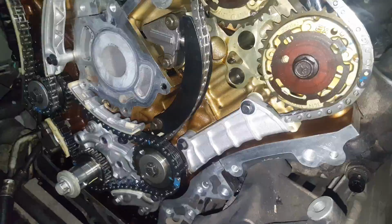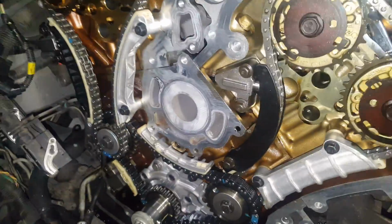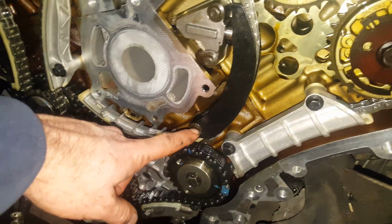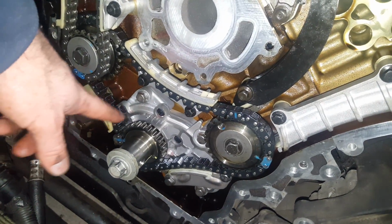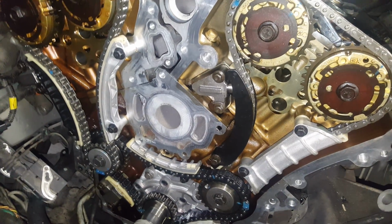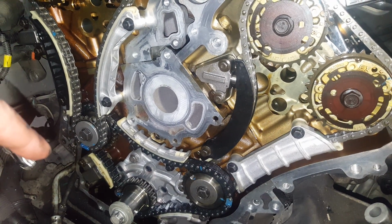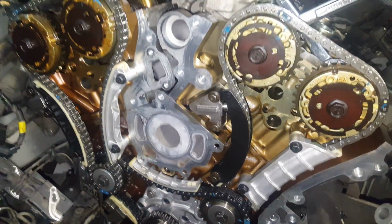Change your oil filter, obviously, and then the torque for all these is 43 foot-pounds. All these are 17: tensioners, guides, and same for the oil pump. That's also 17. The front cover is also 17 across all of them except for the bigger ones. And there's a tightening sequence for that, so we'll cover that in the next video. We've got some cleanup to do.